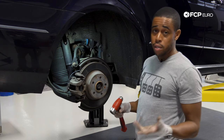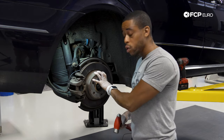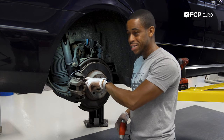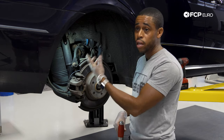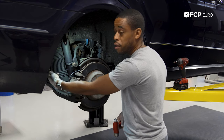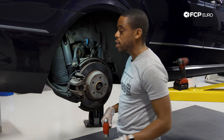To review the components in the rear brake system: we have the brake disc, which we will be replacing today. We've got the brake pads — we're going to pull them out of the caliper. Things you want to be visually checking for are irregular wear on the pads. Also check your brake hoses back here — make sure they aren't cracking, frayed, or bubbling. Those are all bad signs.